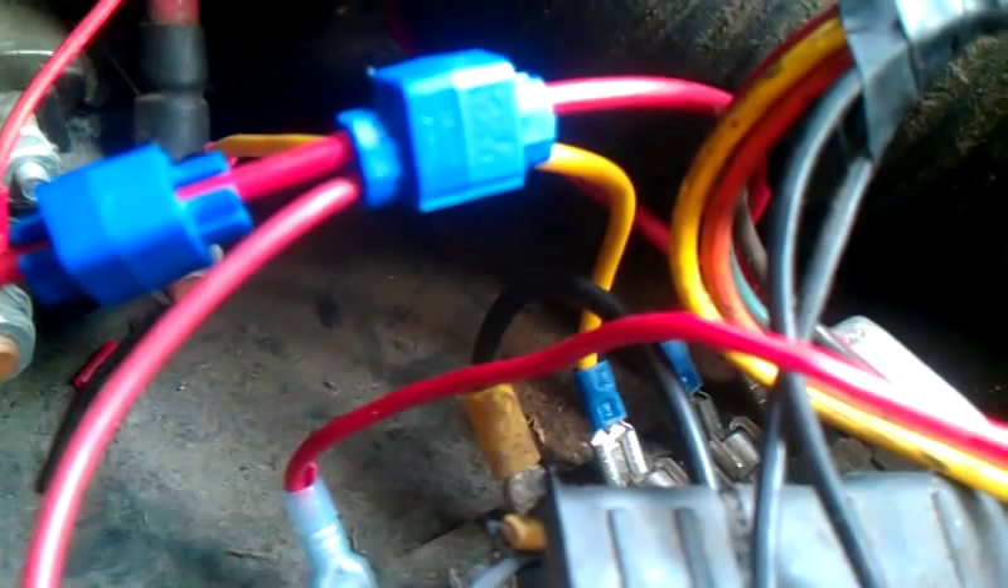I ran my stereo speaker wiring - it all comes into this compartment directly behind the stereo. I have two terminal blocks back there, one for front and one for rear speakers. We'll open this up, and right there is the body solenoid, where the big thick red wire - that's the positive battery cable. The yellow wire coming off of it there is actually the constant power stereo wire. And then there's a red wire that comes off this one - this is the switched power, and I'm running other things off of it too. That's a separate terminal block for other things.